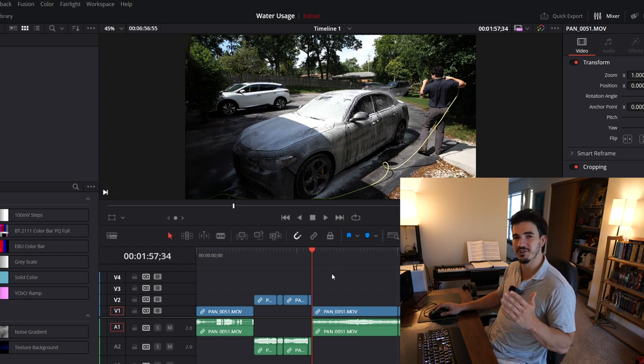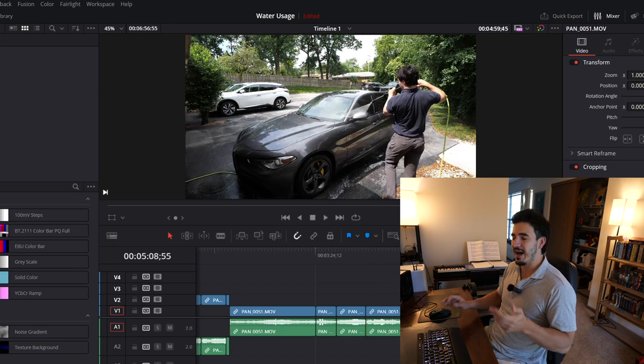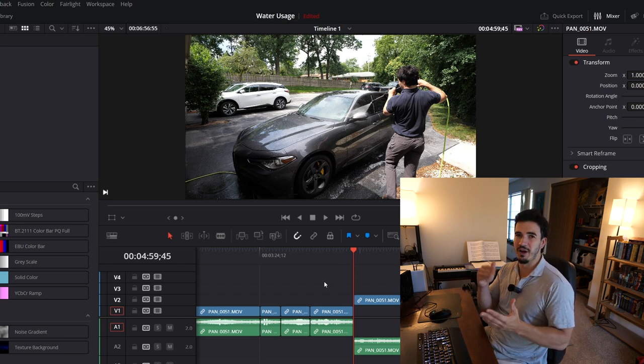The next part is rinsing down the car. After you foam it, you rinse it. On average, I take about two minutes and 30 seconds to rinse down the whole car with my pressure washer. In the footage, one rinse after the foam took me about three minutes, but between the two rinse cycles it was a total of five minutes — rinsing after the foam and rinsing after the hand wash. In another video the two rinses each took two minutes and 30 seconds. So we can assume two minutes and 30 seconds per rinse, five minutes total, meaning I'm using 10 gallons of water there.